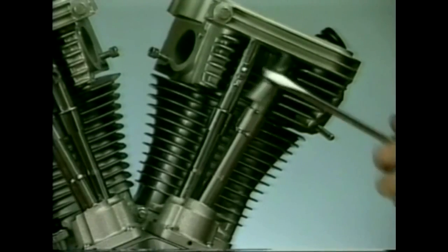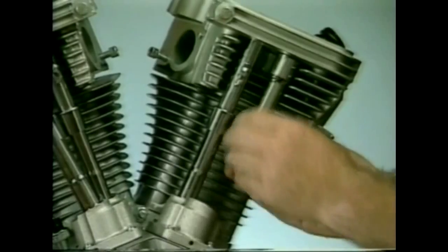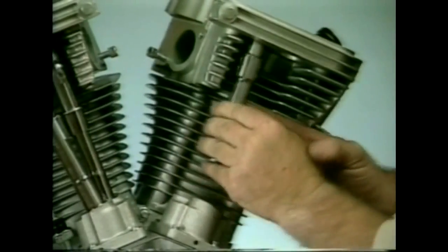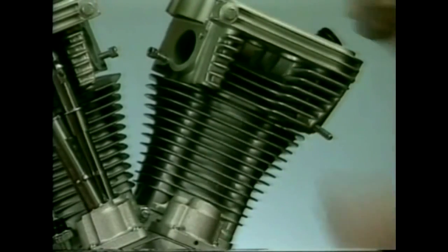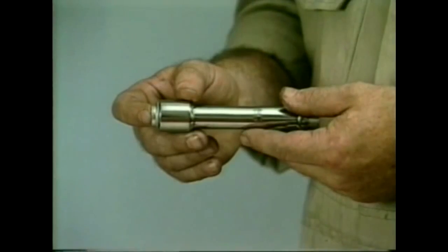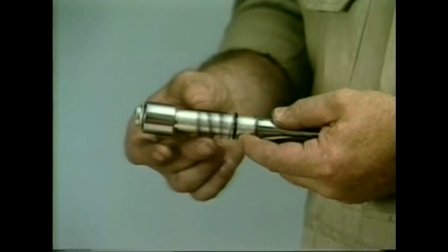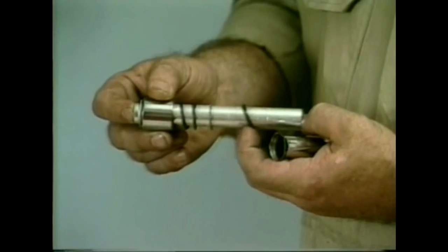With a twisting motion, we remove the pushrod cover's retaining clip with a screwdriver. We then twist the remaining pushrod cover, lifting at the same time to break the seal. Pushrod covers can at times be difficult to remove and may require considerable force. The other pushrod cover on the front cylinder is removed in exactly the same way, as are the pushrod covers on the rear cylinder. We now remove the O-rings from the pushrod recesses in the head — these O-rings seal the top section. We also remove the O-rings and steel washers from the tappet guide holes in the tappet block. The pushrod covers are telescopic. To dismantle them, we pull the top out, hold, and push the retaining cap down. Under this cap we have a spring, a flat washer, and then an O-ring. By simply pulling the top out, the O-ring can be removed.